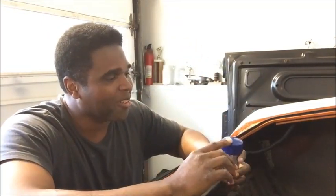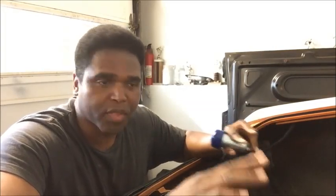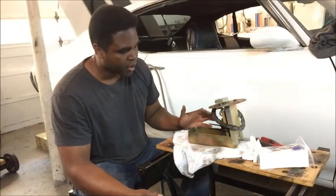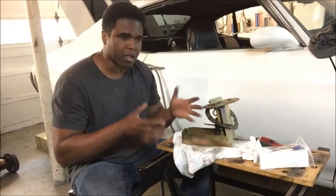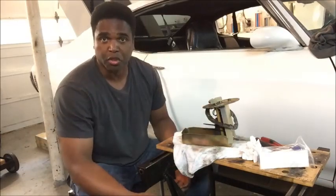We're going to use this P6 because you don't want to starve your fuel, especially under boost. The cool thing about LS engines is you can provide all the PSI and fuel volume you need, but the engine won't use any more than it needs — that's the beauty of these. This is what the baffle looks like: drill the hole, drop it in, bolt it down, and you've got an instant fuel-injected gas tank. I'm going to replace the current pump with the higher-volume unit. Tanks Inc also offers tanks that are already set up if you don't want to drill holes yourself.